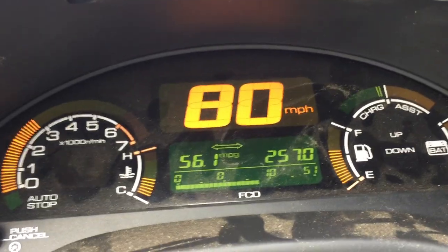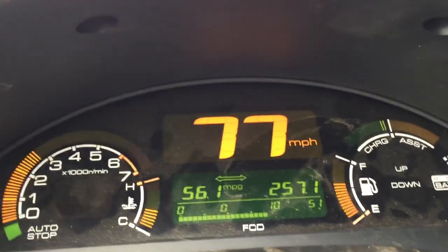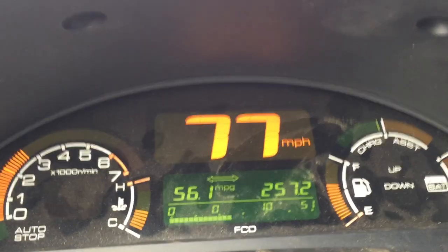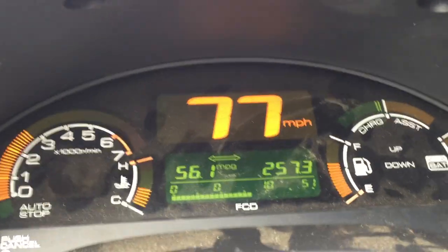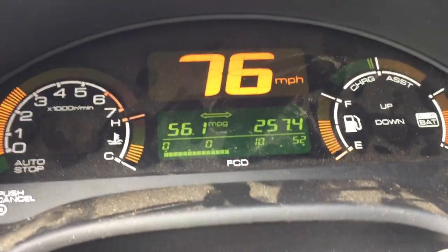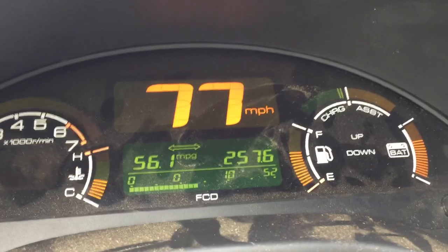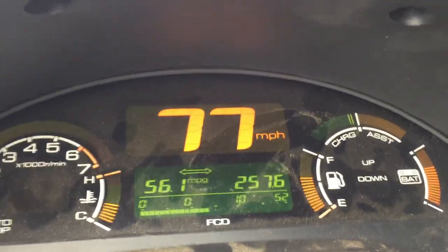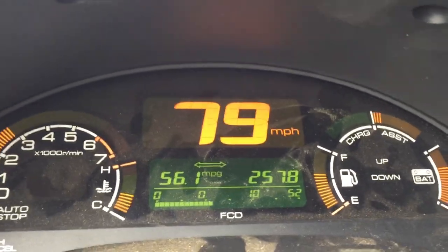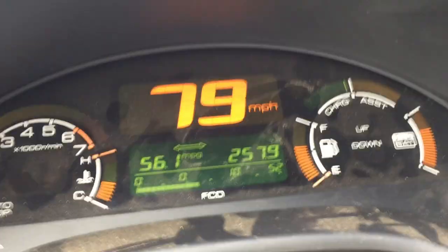Now, I tell you what, as I was saying earlier, this is indispensable because as an engineer, an analog display, even if it's digitally represented, is useless if you don't know what each value is. So there's no label on the fuel gauge, for example. Well, now you can remap that fuel gauge to where each bar is a gallon if you want. And then, of course, it would never be full. Or you could map each bar to be half a gallon, which would be even better, right? Having the charge and assist right now, when I look at that charge, I know that that's pulling between 10 and 15 amps into the battery right now, and that this is, you know, 20 amps of assist. Whereas before, it's basically useless. You only know that it is providing assist to a region.